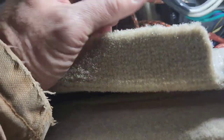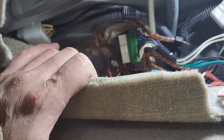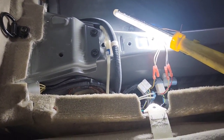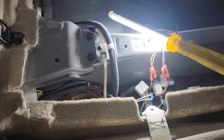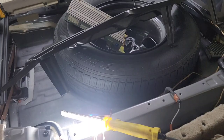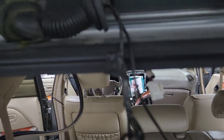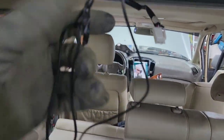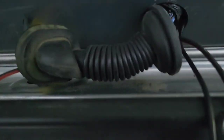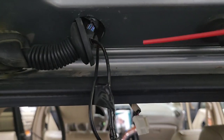I'm going to leave this like this. I'm going to unplug this part right there — they don't need this piece anymore. I'm going to run the jacks to the amp and then from the amp to the stereo system right there. This is more difficult to do — basically how to bypass an amplifier. I think I'm going to spend at least a good four or five hours on this because I'm doing remote start and the whole nine yards. I removed this thing by prying with a flathead, pushed it down and popped it up, then pushed the flat head through right here. I'm going to tie this wire and loop it, then spray WD-40 right through here so it's more slippery.